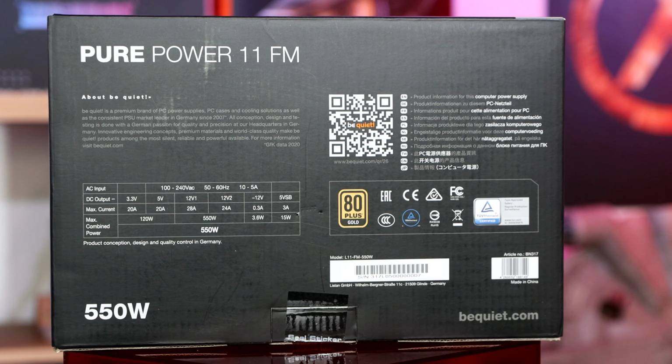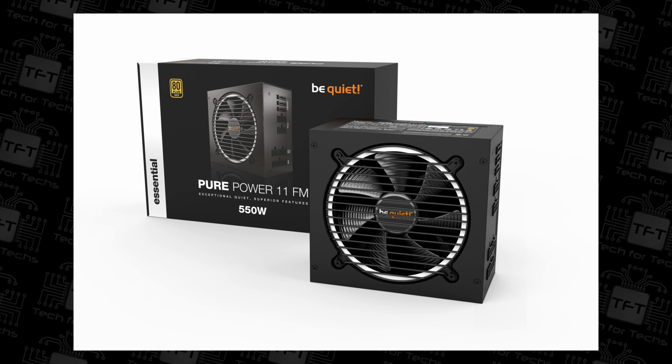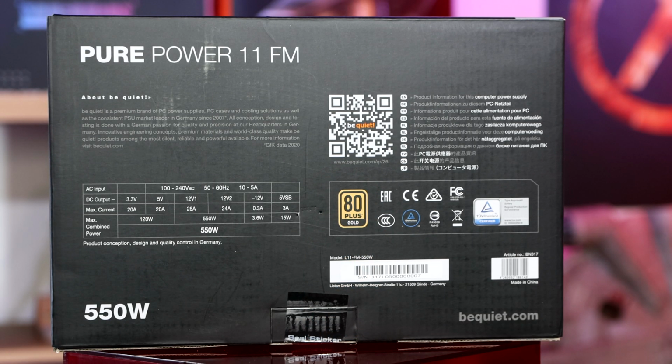On to the specifications, just to give you a rough idea, because one of the first things we get asked about power supplies is, can it support an i5 processor with a 3070 graphics card and so forth? You need to check that information yourself. Every computer is slightly different, has different power draws. There are websites on the internet which will add up the wattage you need, but I always recommend for any power supply you go for, you add 30% on top. So if your total PC uses, let's just say 500 watts, don't use a 550 watt power supply. You need to add 30% on top of that, just to give it that extra headroom, just in case your power usage spikes for whatever reason. Also, you will find that the power supply isn't as efficient when it's working flat out as when it's in roughly the 60 to 80% range. So it gives you a rough idea.